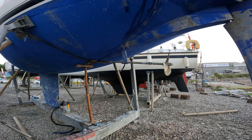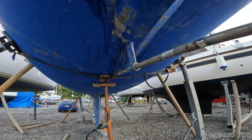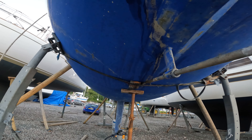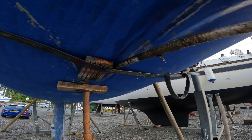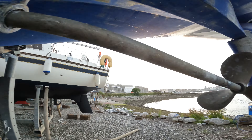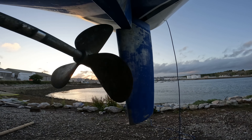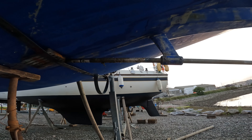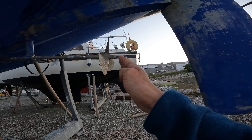Oh, I think that's the fisheye lens — that was freaky, I was looking at the viewfinder and when you do this it makes it look like the prop shaft is really bent. It's quite concerning! It's going to come out — but this is where it could get a problem. That's the end of the prop shaft. Will it get past the rudder? Almost definitely no. It's got to come out about half a meter or maybe more and it's not going to sneak past the gap to the rudder. So we've got to take the prop off.